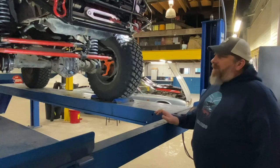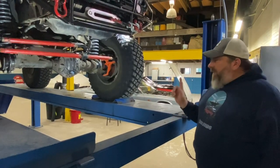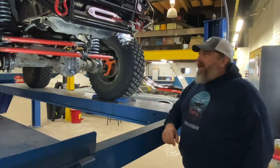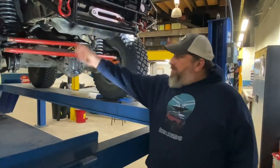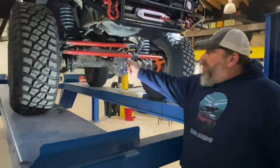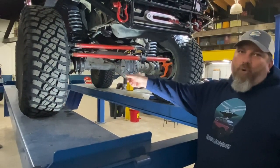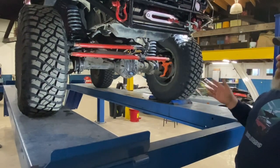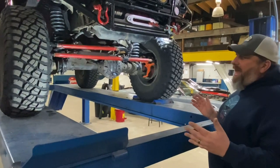So to fix all that, obviously I went to the high steer, the different knuckles. And this axle is out of a '79 Bronco. It is a full width Dana 44 high pinion that I cut down. I cut this end off, drove the cast iron end off, and cut 6 inches off this tube, repressed it on, re-welded it, so it still matches the same narrow width as the early Bronco 44 that I had.